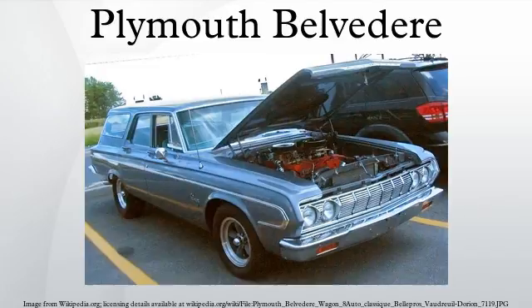The 340 was introduced in 1968 and became one of the most popular and best small-block V8 engines. The 340 had high-flow cylinder heads and a 180-degree two-plane intake manifold. The 340 reached its highest stock performance peak in 1970 with a three-two-barrel carburetor package, featuring a thick web block, specially machined cylinder heads, adjustable rocker arms, and a special intake manifold and carbs. In 1972, the 340 was bumped down in compression from 10.4:1 to an emissions-friendly 8.5:1, and shortly thereafter came the 1973 oil crisis.